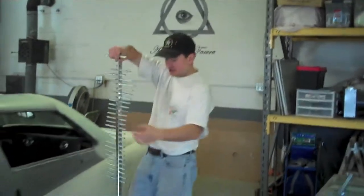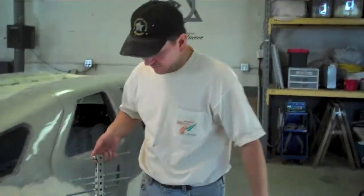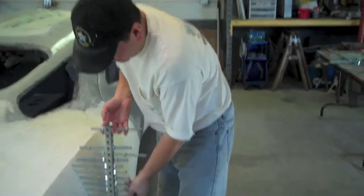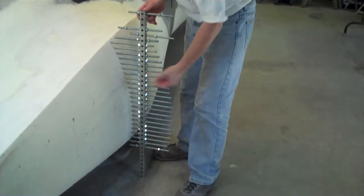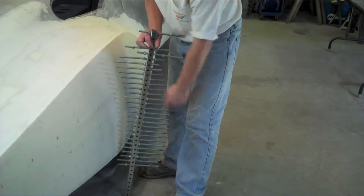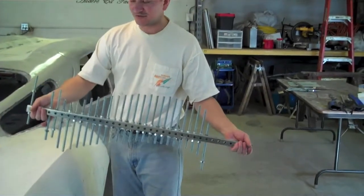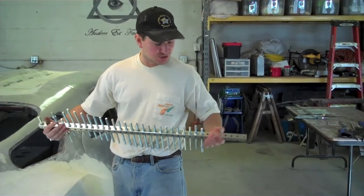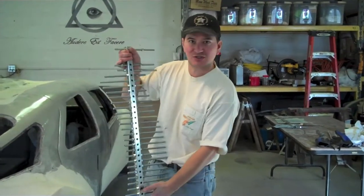I'll show you one here real quick. We put parallel lines down on the floor next to the car for doing the side profiles, then set this up even with that parallel line, check it with a square to make sure that we're vertical, and then we just loosen and tighten the bolts to get the profile. How we made this was just threaded rod, a bunch of bolts, and a 36-inch piece of square stock with holes drilled in it. We chose bolts that were just slightly bigger than the holes so we could drill them out and make sure they were tight and would stay straight.